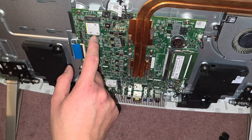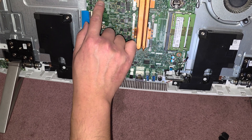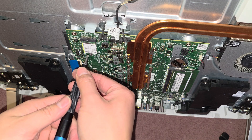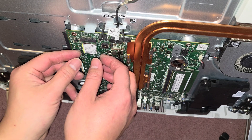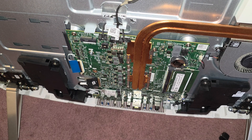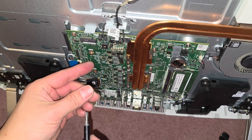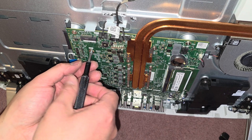It looks like there's a small M.2 PCIe NVMe SSD right here, so you can put a full-sized one. You will have to move this little mounting bracket over as well. We're going to switch over to a PH1 screwdriver. Get that screw out, then this pulls up slightly — be very careful, pull slowly, there's a thermal pad sticking it down. Then you can take that out. Switching back to a PH2, you can take this screw out and move it down here to upgrade. Instead of a 2230 M.2 you can switch to a 2280 M.2.